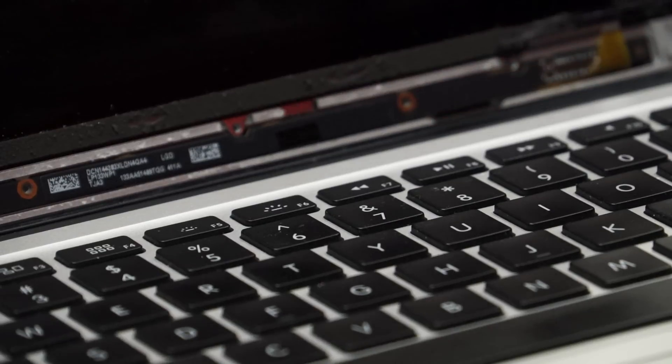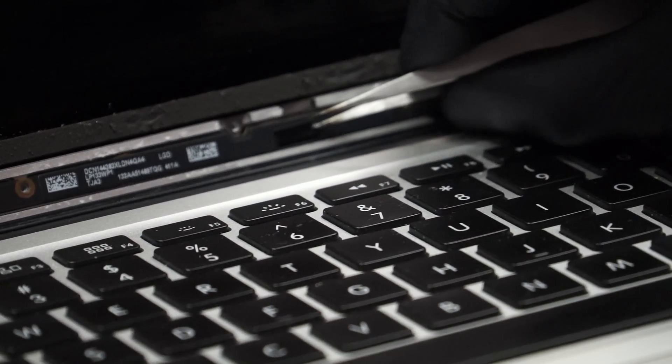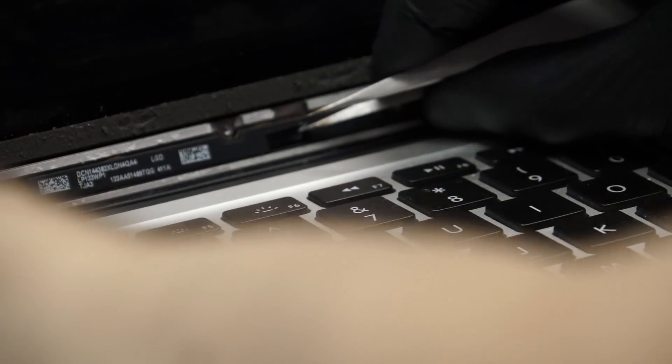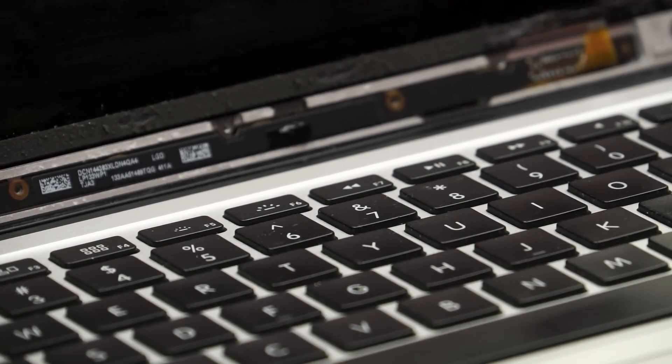Now, more hidden stuff. See this over here? It's like an optical illusion. We have this little black piece of tape on this black PC board, and that's going to a cable behind it — a cable that's really easy to rip. And you know what happens if you rip the cable? You have to replace the backlight. And when people replace the backlight, they mess up the layers and it doesn't look the same. Think of this like a really shitty video game.